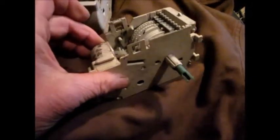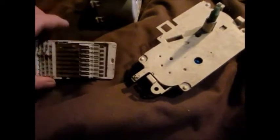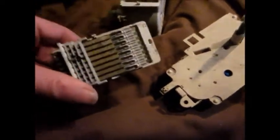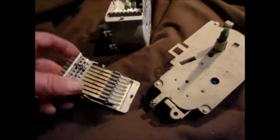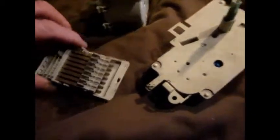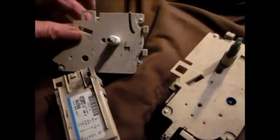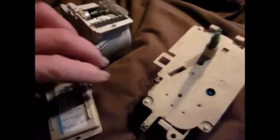They have this little thing that pops off the top — these are the point sets that come off the top of the timer. There's a little sort of notch right there that the hole sets in; you stick a screwdriver there and you can pop that up. Then these side tabs basically hold the points in place.